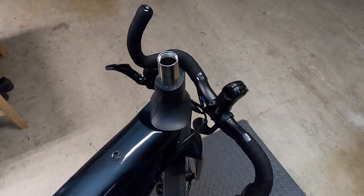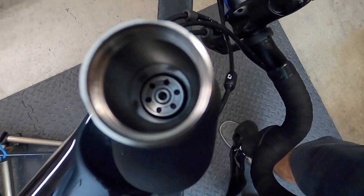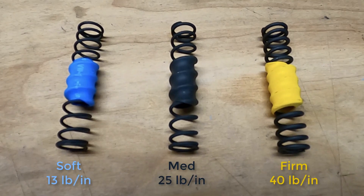The base 1.5 has a main internal spring, but if the default spring rate is too soft for you, you have the ability to bump up the effective spring rate by adding one of three additional helper springs. Depending on the bike you have, the helper springs will either be linear or progressive, but on the 1.5 model you can essentially choose from four distinct spring rates to help soak up road chatter in the front end. It's important to note that there is no damping adjustment on the Future Shock 1.5 model.